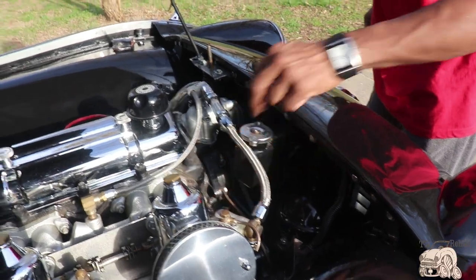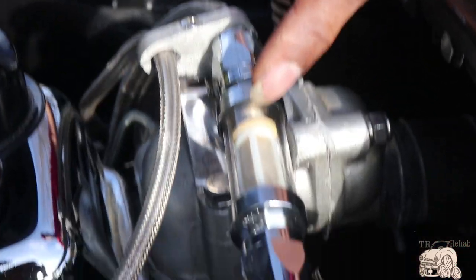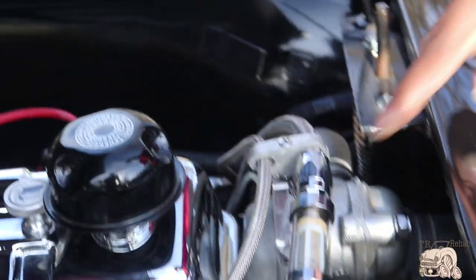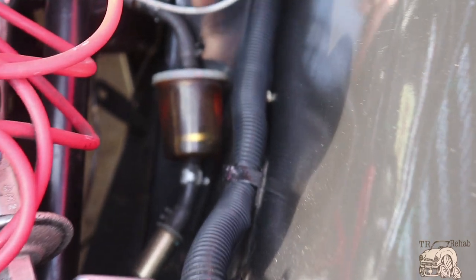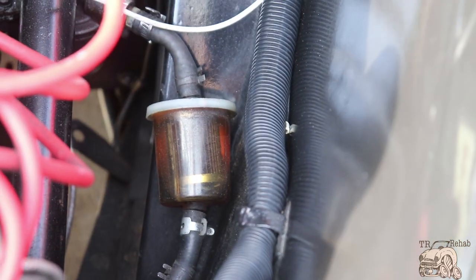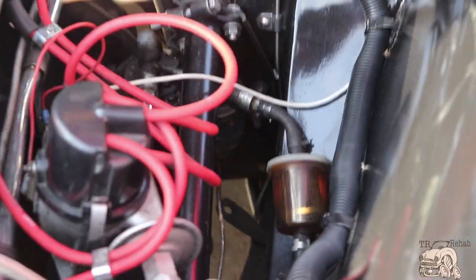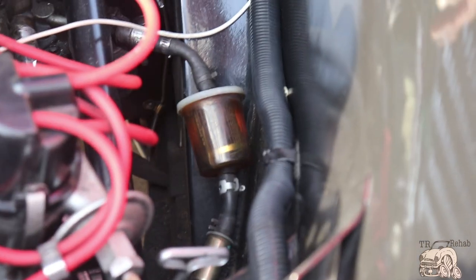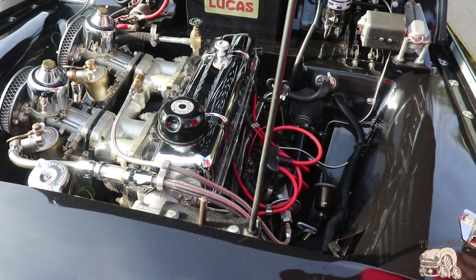It'll run for a while because you've got a little fuel in the bowl, but you can see that's gone. That is absolutely telling me there's either something clogged in this line — which I doubt, because there's no way it could have been full a little while ago and then suddenly be clogged again. My inlet filter is full, so I'm getting fuel to the fuel pump, and my bowl is full. I'm eliminating a clog from the tank to the fuel pump. I'm going to say the fuel pump is going bad, if it ain't bad altogether.